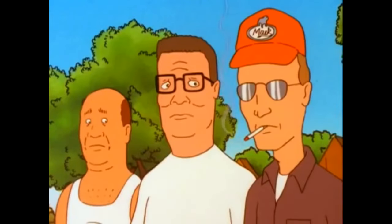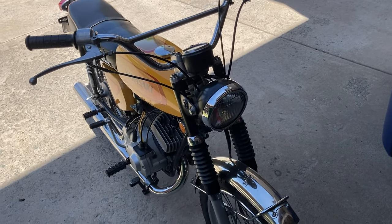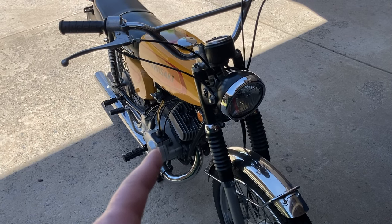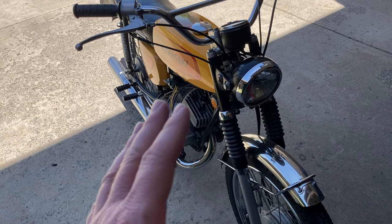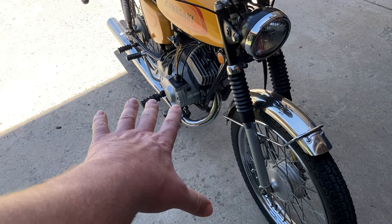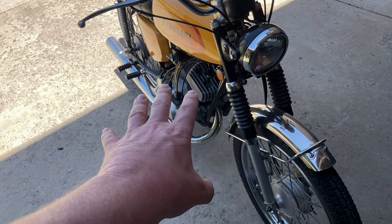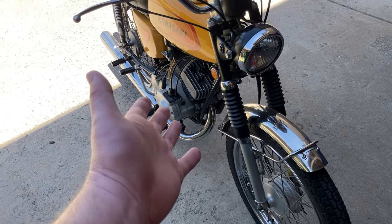It didn't actually work as intended — flooded like crazy, it would just flood out and not run right. We found another carburetor from a bike that had apparently never been off the bike before. Other than being filthy, mechanically it was perfect — no wear or tear at all, essentially a nearly brand new carburetor. My dad bought a sonic cleaner, found the carburetor, put it in the sonic cleaner. When I got back to Texas from visiting my old hometown, I installed the carburetor and we were in business.